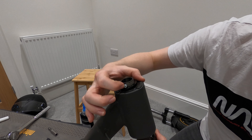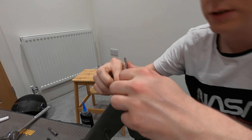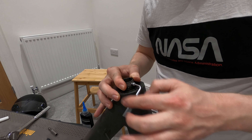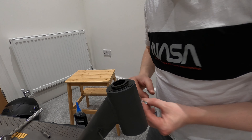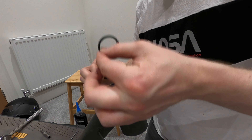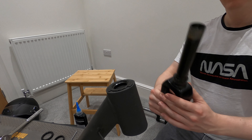There is a little pin here holding everything together, so we're going to go ahead and take that out — it's a three millimeter hex key. That's just a retaining pin to stop everything coming loose. And the suspension just drops out. So there are two essentially washers — we're going to keep those, put this one to the side and also this one. And there we have it — our fork is now out.